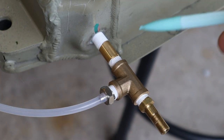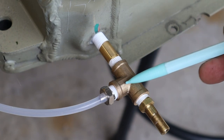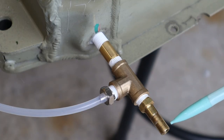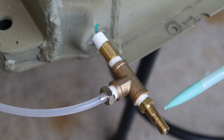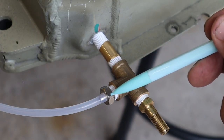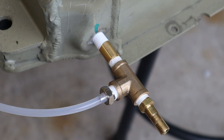What this is, is just a short piece of brass pipe, a T-connector, and a Schrader valve. This is just like what you'd have on a car or bicycle tire. It lets you put air in, but as soon as you release, that valve shuts up and the air can't come back out. Over on this side I just have a very small hose barb connection, and then this hose is going up to the manometer.